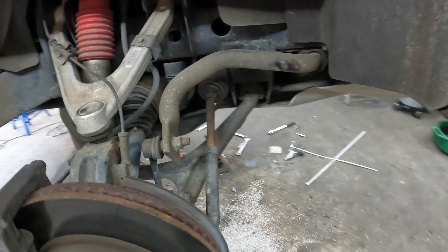First task is to pull this cross shaft bolt out — I did pull it before I started filming, so I forgot to grab my camera. Just pull that out and it kind of flops around. There's a 10 millimeter here and those are 18 millimeters, so let me pull that out and get this control arm to come up.